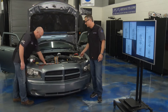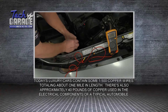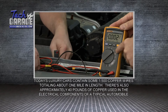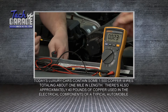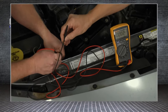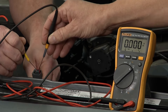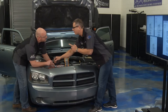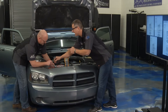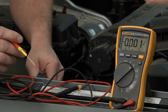We'll start by making sure there's no voltage. Let me get this right front sensor connector off. We're set up for DC volts — that's what we need. I'll go ahead and hit one post, and you go in the other one. Remember, it's unconnected, so what should we see? Zero volts — that's a good thing. If we saw voltage with it unconnected on both ends, that means some wire is feeding it power, and that would short it out and cause loss of communication. We're good — we got zero. Voltage test is okay.